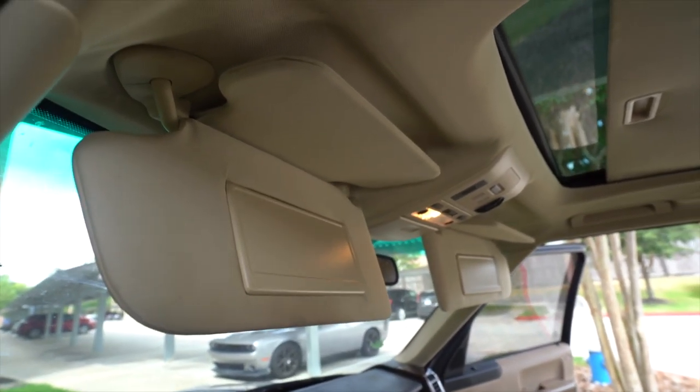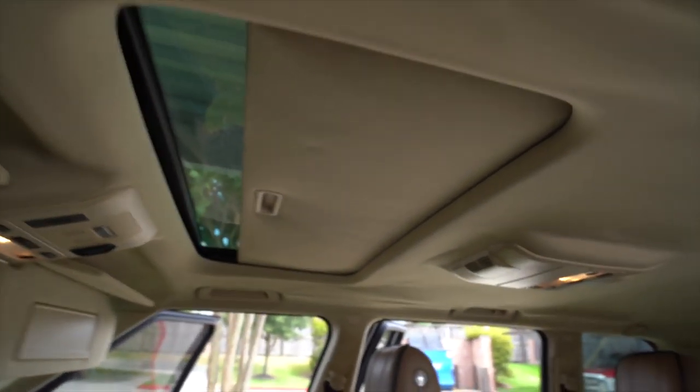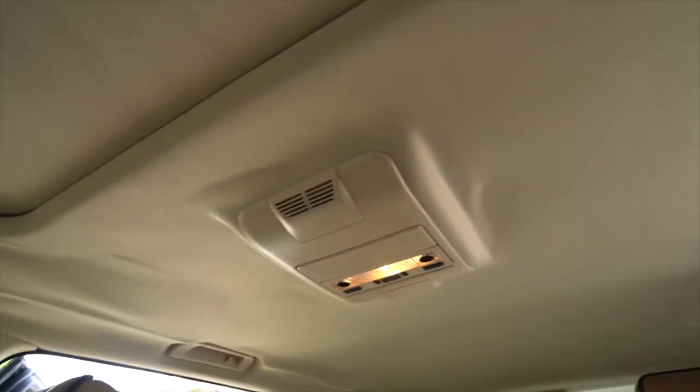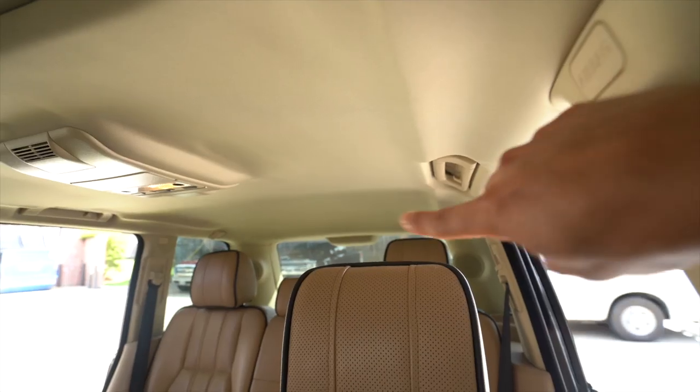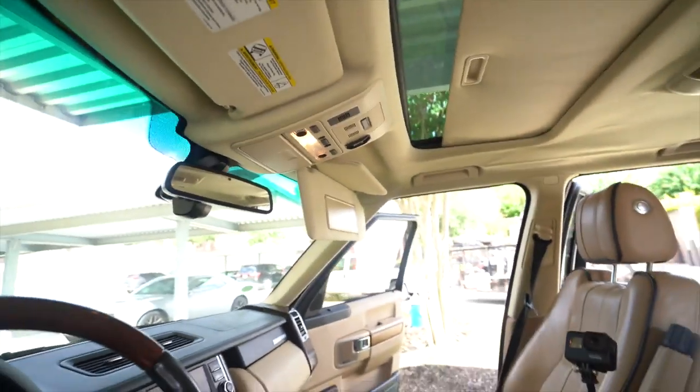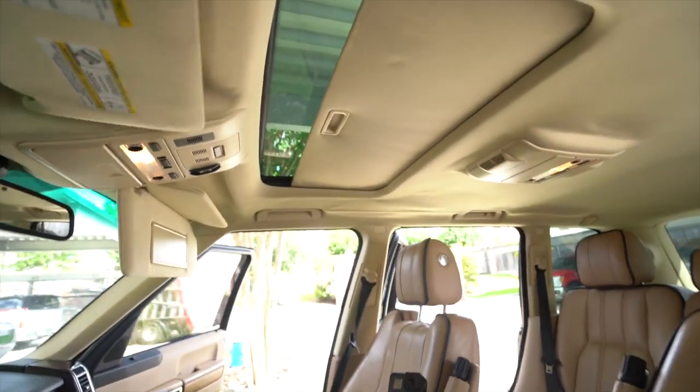And there we are, cleaning headliners. Showed you a couple different methods on different stains. I basically followed those exact two methods with either the drill brush or the regular bristle brush, a small one, and went around the entire headliner. I didn't know there were big marks here on those corner edges right there. Tried to touch those up, but overall, pretty straightforward. Came out great. Still needs to dry in some areas.